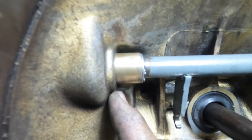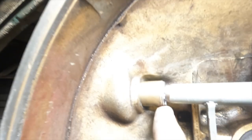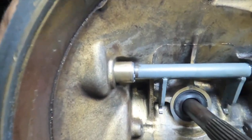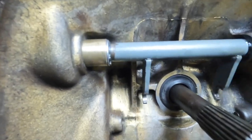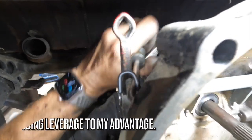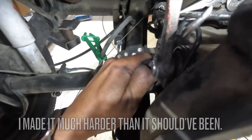So we've got our new bronze bushing in there. We've got to get that spring back over but we do have our circlip on the end there, and our new circlip and our one spacer that we needed to get the throwout shaft centered. Make sure that this sucker moves, because if you miss the index hole in this you'll crimp it to where this shaft will not move. When we need it to move for the spring, it's going to snap it right back once we put it on there. So you've got that spring just hanging out there - I'm going to take a tool and come around the back side of it.